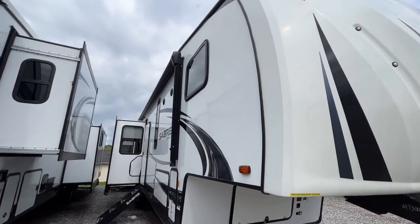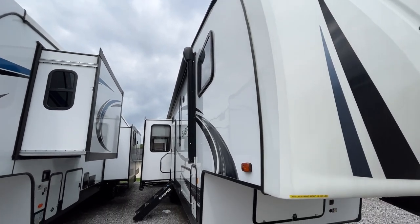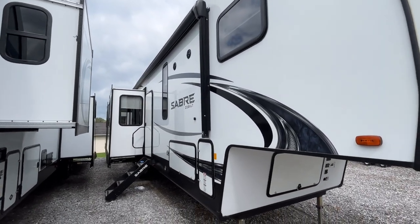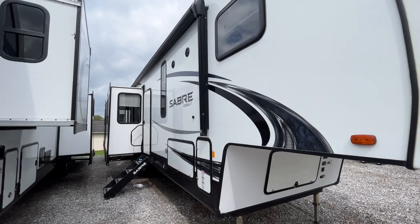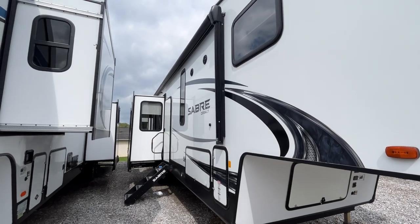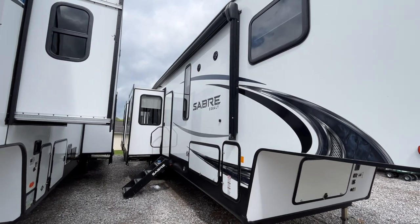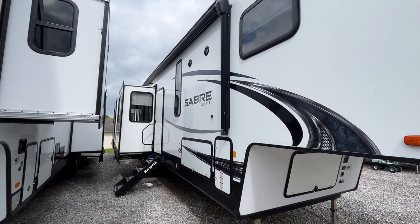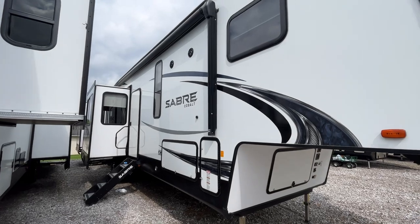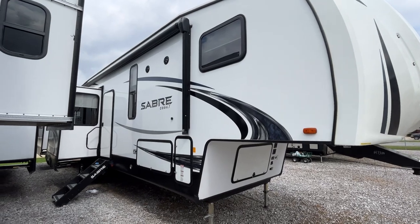You see on the outside there's no waves, no bubbles. If you're first time looking at RVs, you want to make sure there's no bubbles on the exterior — that's called delamination. That's separation from the pressed interior wall and the insulation. That occurs sometimes over time. You just want to definitely make sure the inside is not all crunchy or soft. I think this one's in real good shape all the way around. We're going to walk around it.